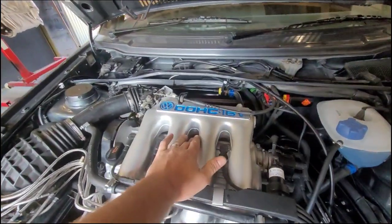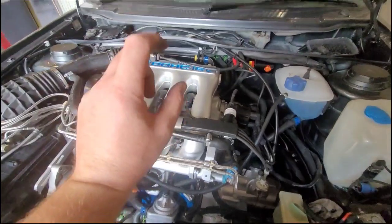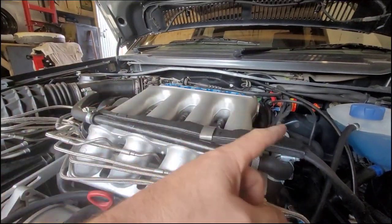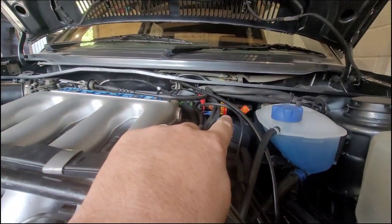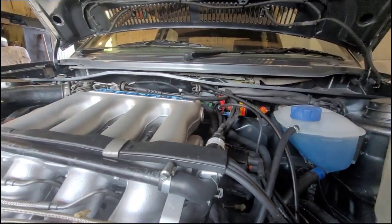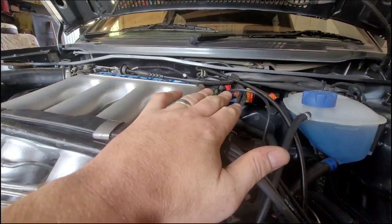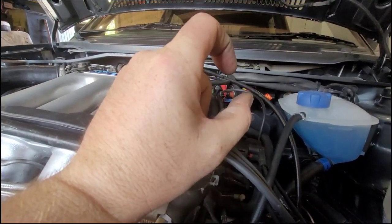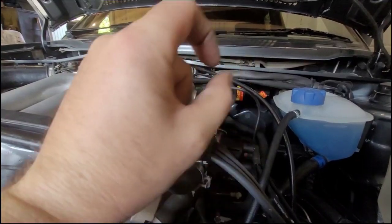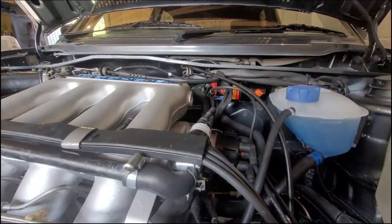There was a tiny bit where I could take off two of the leads, like one and three or two and four at a time, and have them unclipped but hovering above the spark plug so the spark can jump, which means there's a bigger spark, which led me down to, well, am I getting a strong enough spark? So all I've just done is taken the coil back off and redone all the connectors on it, so they're all fresh connectors. Started it up and there we go, the minor misfire is gone, just down to dirty wiring. You only need about five mil of wire inside that connector to be corroded and it's not going to let the electric cross it. So the engine's running, well happy with that, sounds beautiful.